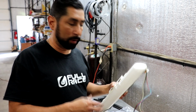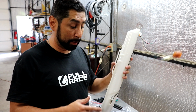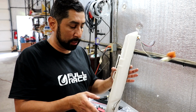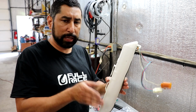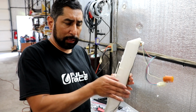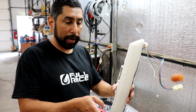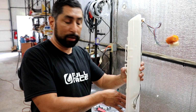Here's why I have this out right now. The pumps. I had a hard enough time sliding the Y pumps where it goes across the saddle. I'll get you some in-tank shots for that. There's a saddle in the tank. I don't know why they put it there, honestly, but there's a saddle in the tank where the pump used to go. I believe it was on the left side. The sending unit was on the right. But for my dual pump setup, I had it wide. One was going under the sending unit, and one was going to the left in that saddle, right?